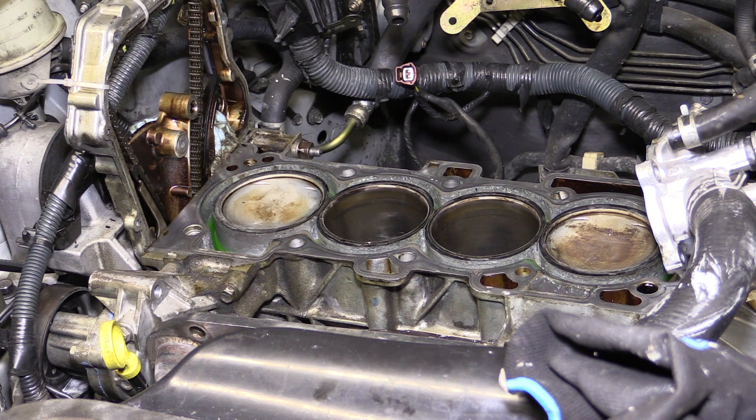One of the reasons for this is because there's a difference in temperature between the cylinder head and the engine block of about 27 degrees that Nissan purposely engineered to help improve emissions. However, as a result, this causes a difference in expansion rates between the cylinder head and engine block, and consequently over time, the engine blows its head gasket.